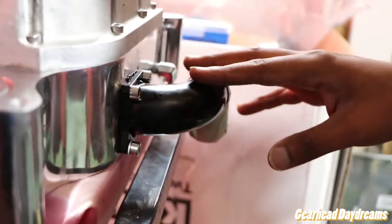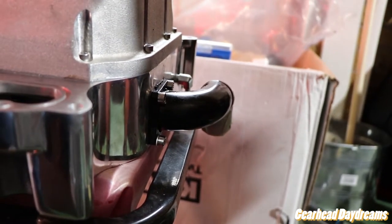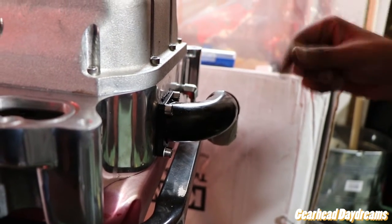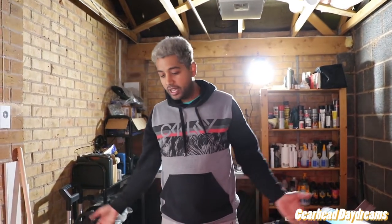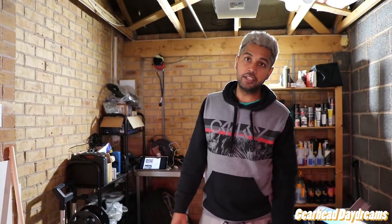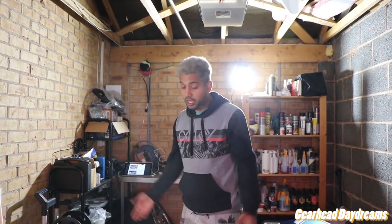The moral of the story is, stick to the torque specs, because if it's not going in and you threaded it properly, then there's something wrong, and in this case they just weren't tapped deep enough. It's not a huge issue. I had an M6 tap with me anyway. I should have just done that, to be honest, but that's what happens at 2 a.m. Yeah, exactly. So, live and learn. I've been in much worse spots.